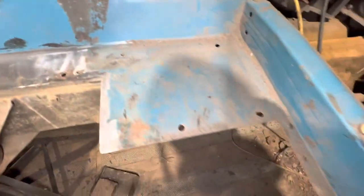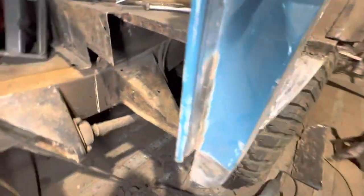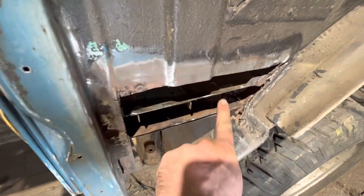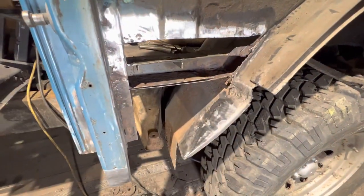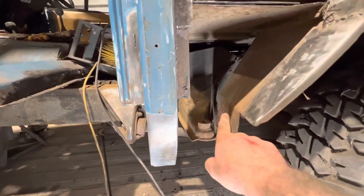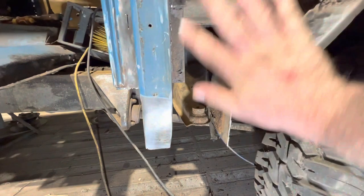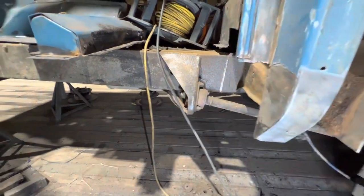It's starting to get there now. All I've got to do is repair the section in here, so I'm going to make a couple of lips - one for this bit and one for this bit here - and then make a repair panel which will cover this whole section. I'll actually put that panel in last because the seal panel allows me to weld across here, weld down here, and weld all in here, and then the closing panel can go over that at the end. I also need to make a small half-moon shaped panel here.